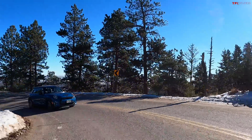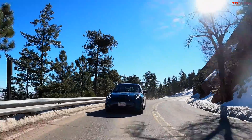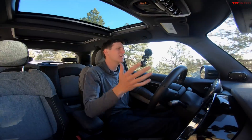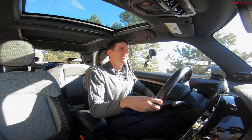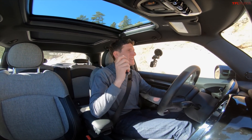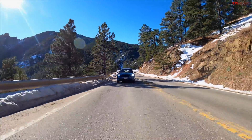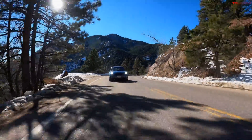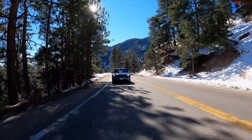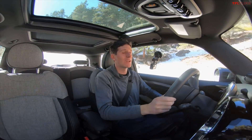In the last 4,000 miles we've owned this, I've gotten into several stoplight Grand Prix's with much quicker cars — you just give it a little force of electricity and go blasting off. Sure, 114 miles is pretty limited, but the nice thing about a small battery is you don't need to upgrade your house to charge it. Even on a 110-volt outlet you can drive your commute, plug it in overnight, and it's good to go by morning. A 240-volt outlet will charge it in a couple of hours from dead to full.